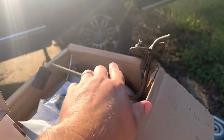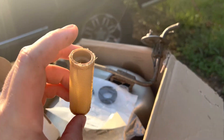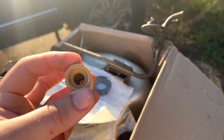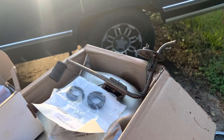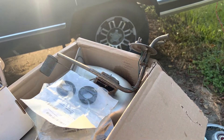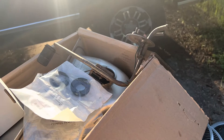I see no reason why we can't reuse this one. With a new filter screen — I'll put a part number in the description, I think it was off of like an F-150 or something of the same era. The sending unit itself, if you need one, you can get it — I found it on eBay. There are two listings on eBay. This car has a low fuel light, so if you look on eBay you'll find two different sellers with a sending unit listed for this car.